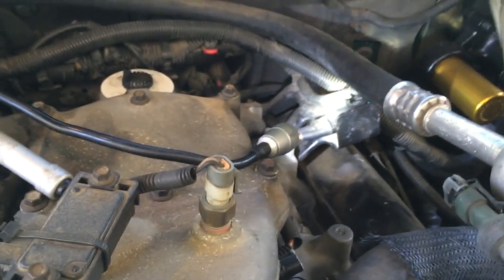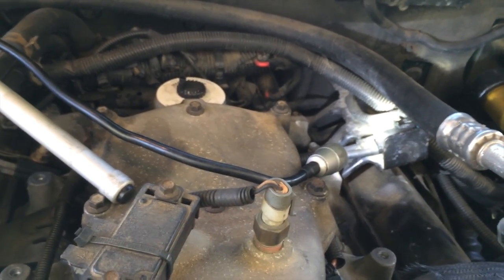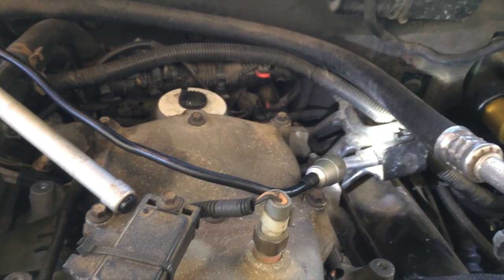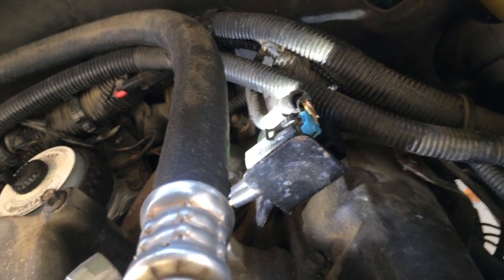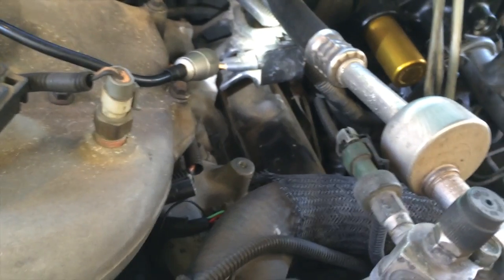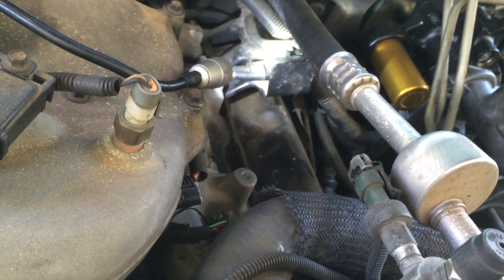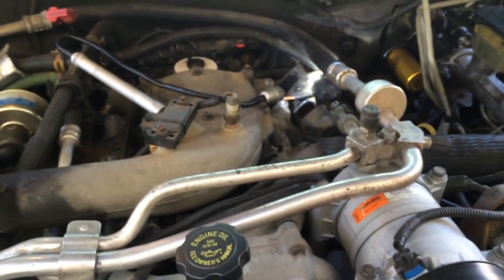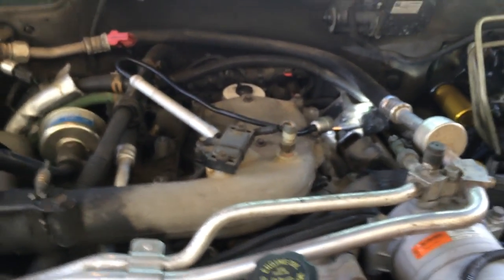Before signing off: I had trouble out of the box with this wastegate solenoid — first put it on and still wasn't getting vacuum at the actuator. It turned out that in shipping the solenoid had gotten jammed. Before returning the part, I ran it over to the battery and gave it direct 12 volts into the back connector — normally it gets its signal from the powertrain control module — and that unjammed the solenoid. I heard it click. It's a good test when you get the part: make sure you hear that click before wasting time chasing a bad replacement. Also, you don't have to clear the P0236 code — after the PCM decides it hasn't seen the problem in three runs, it'll clear the code itself. Thanks for watching.